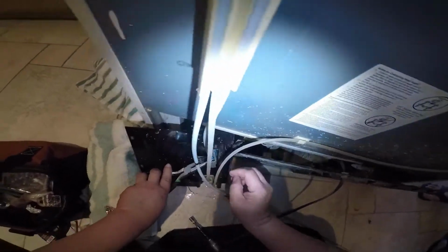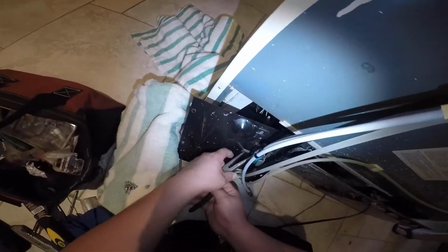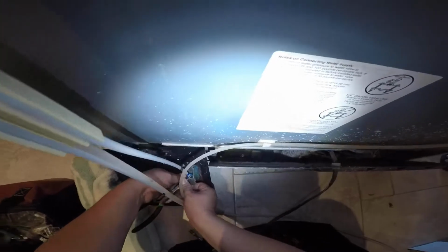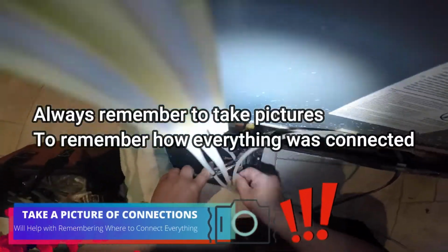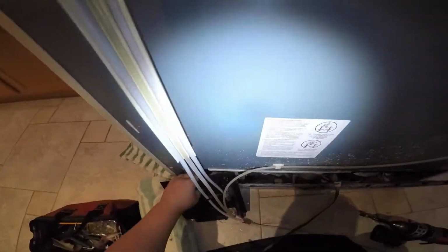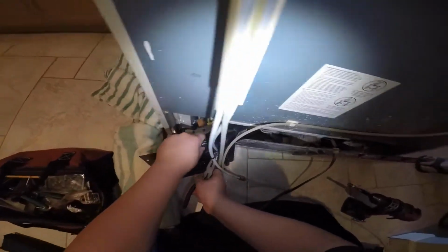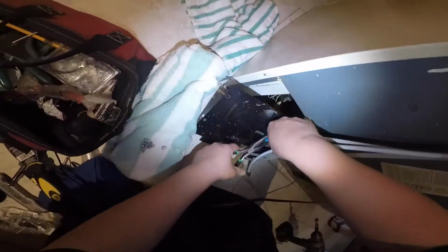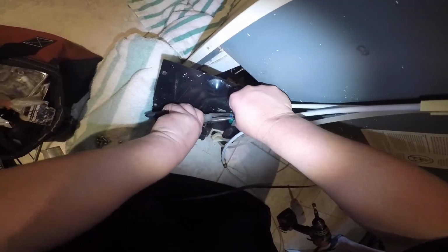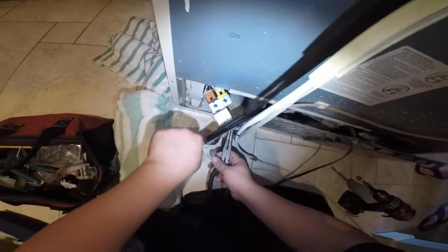As you can see in this footage, we're gonna go ahead and press and release the water valve. For some reason, I find that all the Whirlpools and Maytag, which Maytag is made by Whirlpool after 2006, to remove this piece of water hose is kind of difficult from the old water valve. So sometimes I like to cut just the water hose and then attach the new water valve.